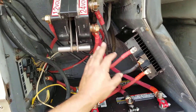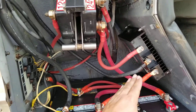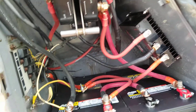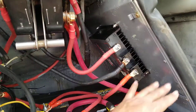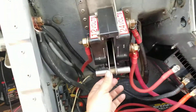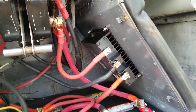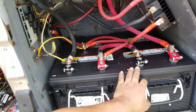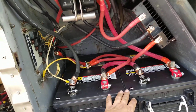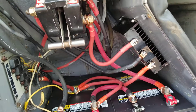Don't be afraid - the Vanner is connected all the time and has power all the time. It doesn't matter if the cutoff switch is off; that Vanner has to have power all the time. The reason is because if something starts happening between these two batteries, that Vanner needs to kick in and balance those batteries before you come in for your next trip and turn it on.